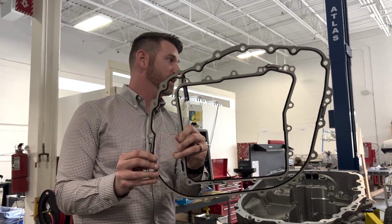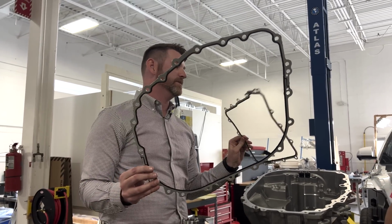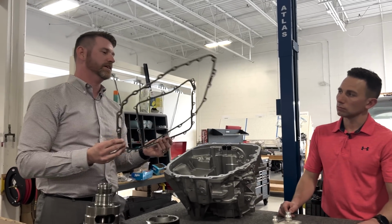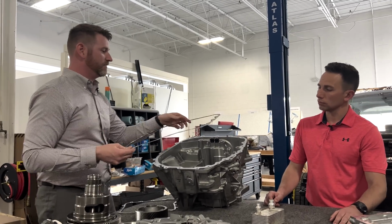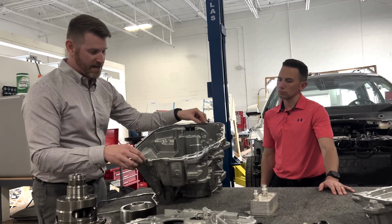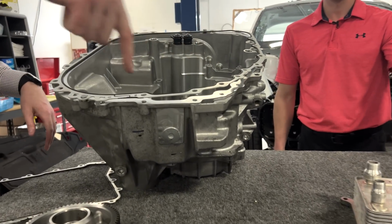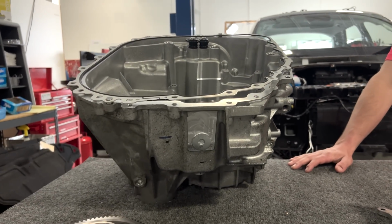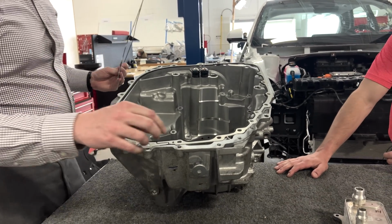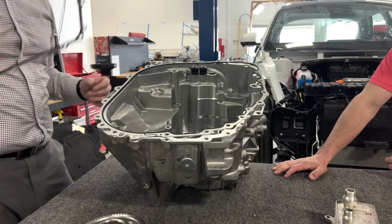But you're seeing that, in contrast to an RTV seal, there's money to be spent here because it's an expensive material that's being loaded into a tool, shot over and overmolded. It's nice from a cycle time perspective for building these, because you can essentially just nest, drop on, this gets loaded, versus the time it takes to apply the RTV. So that might be one aspect of why you're paying the money to do something like this. And then potentially, depending on mileage threshold, maybe it's also a serviceability enabler for them as well.